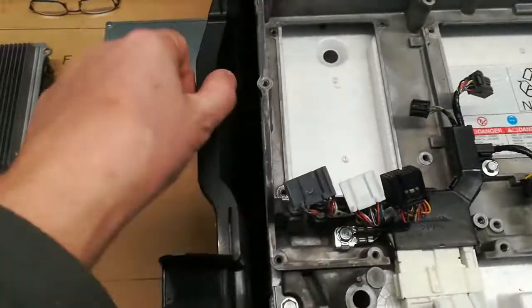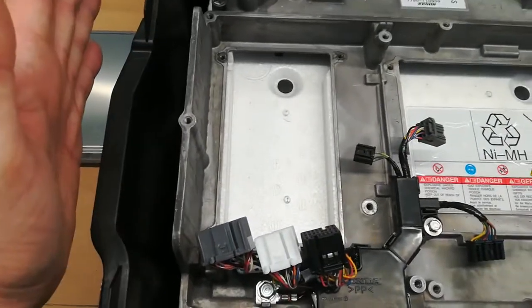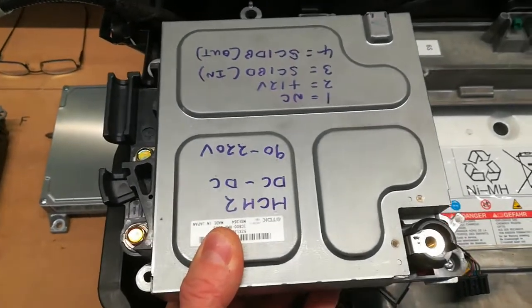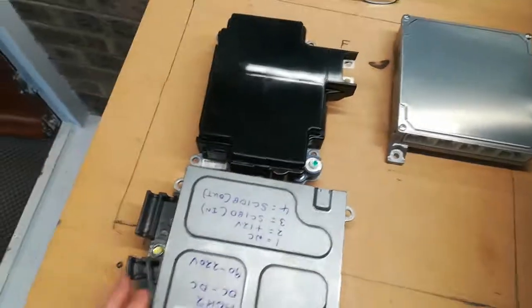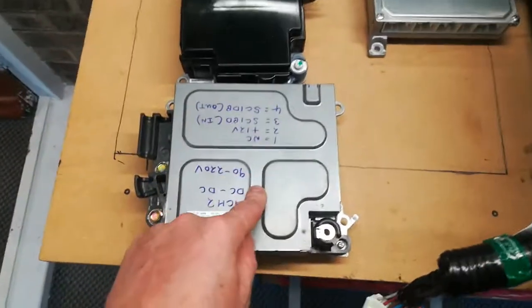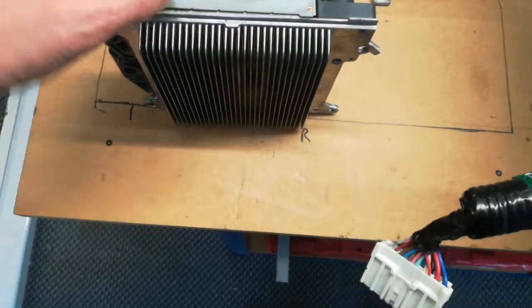Basically then we have some overhang at this side. As you can see, there's quite a bit of room in here between this and the actual edge of the unit case — the actual wall of the wheel well. So once we've got this in position with the edges machined off, it will probably drop into that space. The height of this unit is exactly the same height as the CRZ IPU, so height is not an issue. We just need to drop it into this slot and machine the heat sink down.